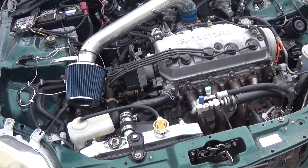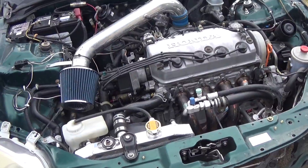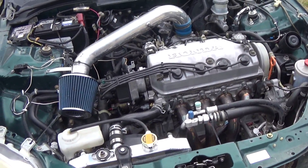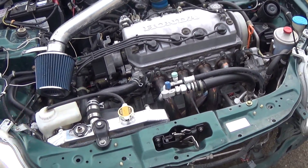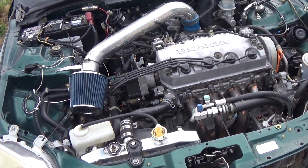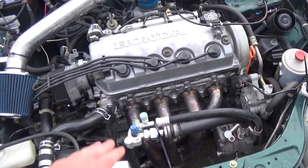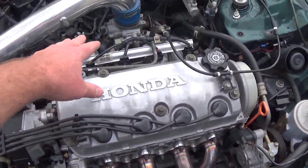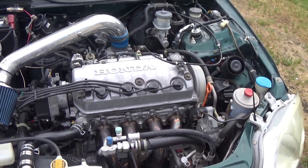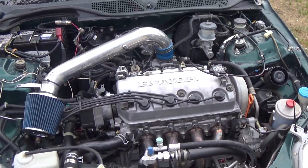So when I started on this — kind of changing subjects a little bit — I went to start it and boom, it wouldn't start. I got the engine to turn over but it just wouldn't fire. They call that a crank no start. There are typically two reasons why that's going to happen: you're either not getting spark or you're not getting fuel — or something's interfering with the spark or the fuel.